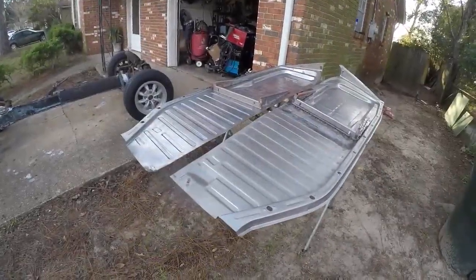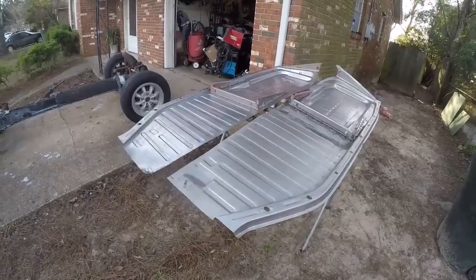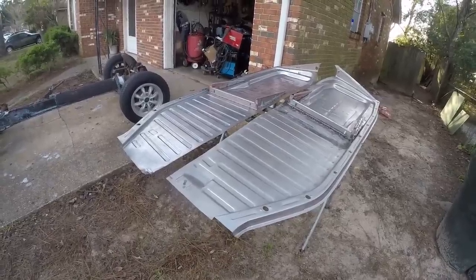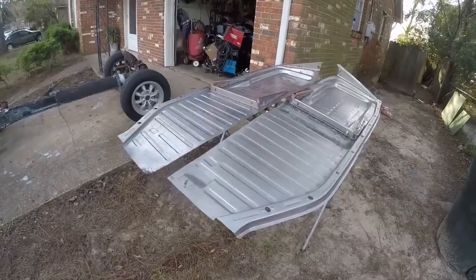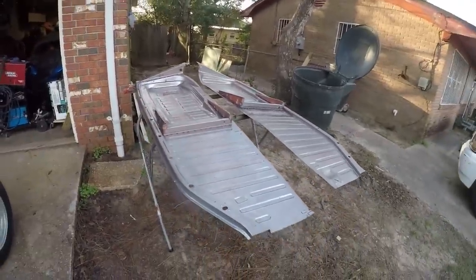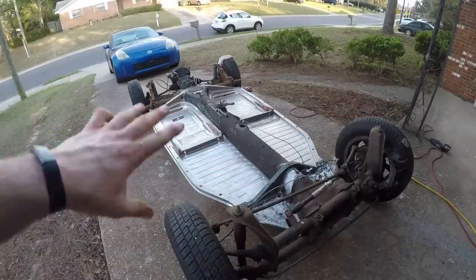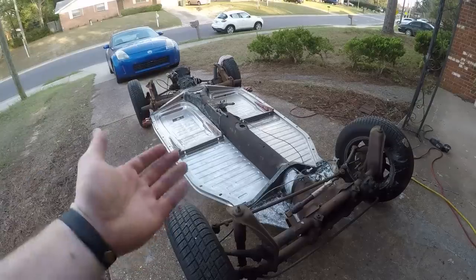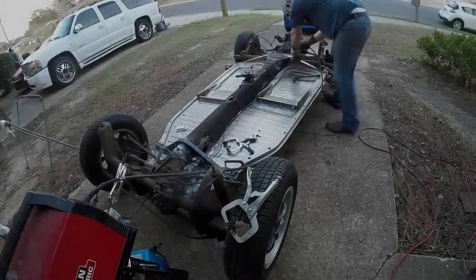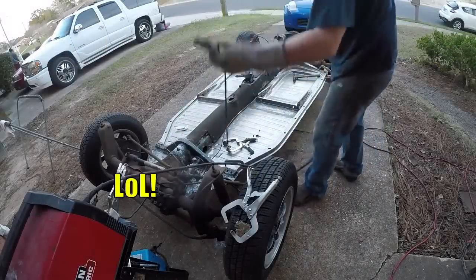You may see that there's still a little bit of orange on there, but what we're looking at there I'm just going to wire wheel off — it's just a bit of a haze. After three applications of paint stripper, if it's not coming off it's pretty well fixed, so you shouldn't have any problems with it peeling. I'm going to let these dry up a bit, and then we're going to start welding. We've got the pans dropped back into place — they should be good to go. I'm going to start spot welding them in place, and afterwards we're going to do that wire wheeling, then comes a coat of paint.